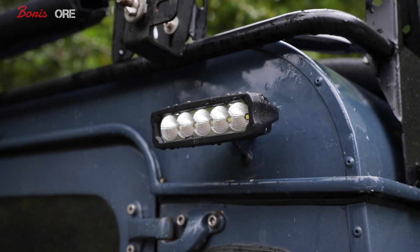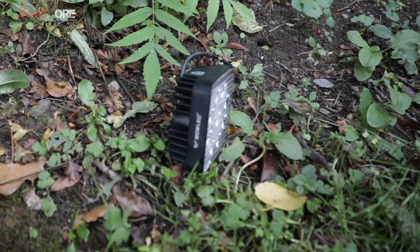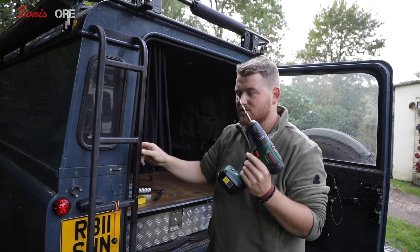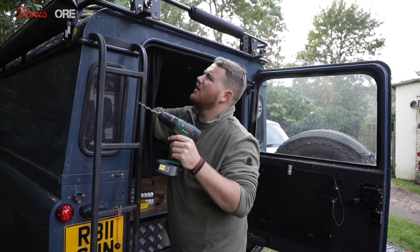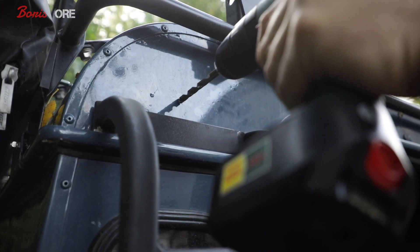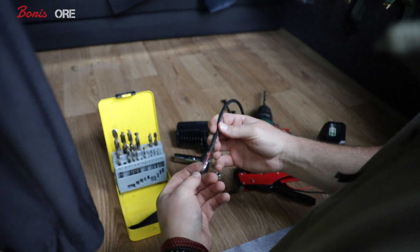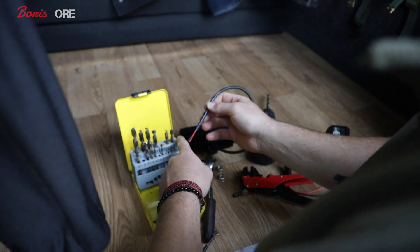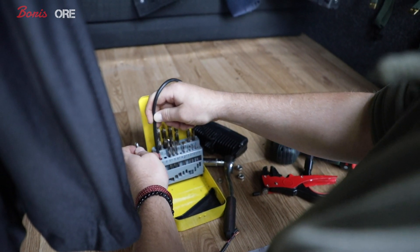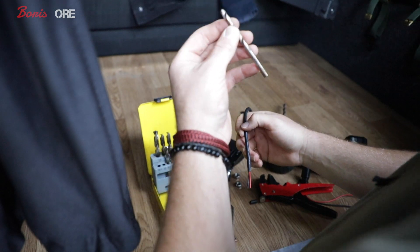So on that one there we obviously have the old one — this rusty old full-of-water rubbish one. This time though, unfortunately there's no holes so we've had to measure it out and make sure it's in a similar position to the other one and use the appropriate drill bit to drill a new hole. And then after that I'm going to drill another one so the wire can go in and be wired up. So this is the wire coming out of the back of the light and I now need to drill a hole. A sort of cheaty way of seeing what size the hole should be, you can use a drill bit set and measure the hole on there — just remember the drill bit's a bit bigger. This one is a 6.5. Let's drill the hole.